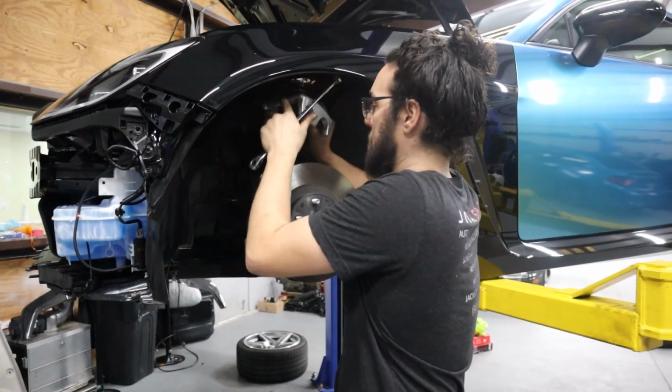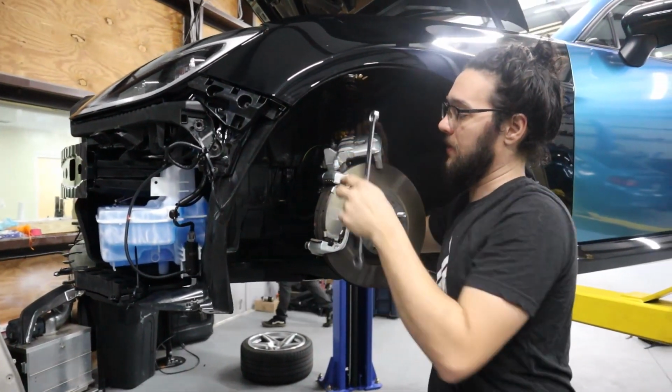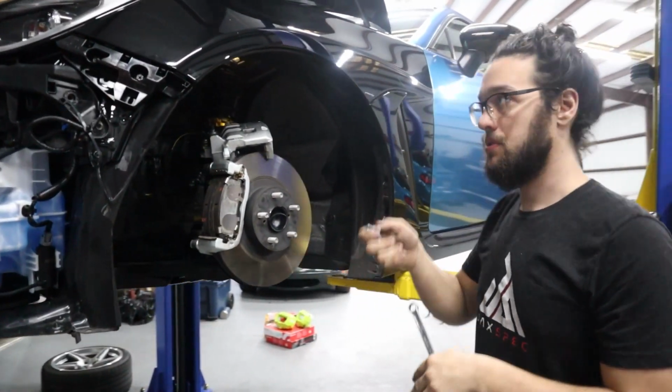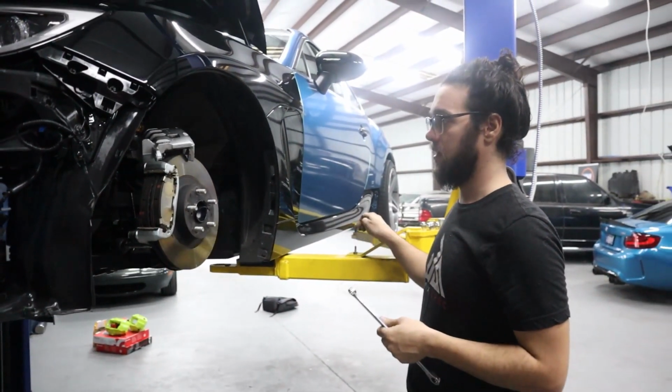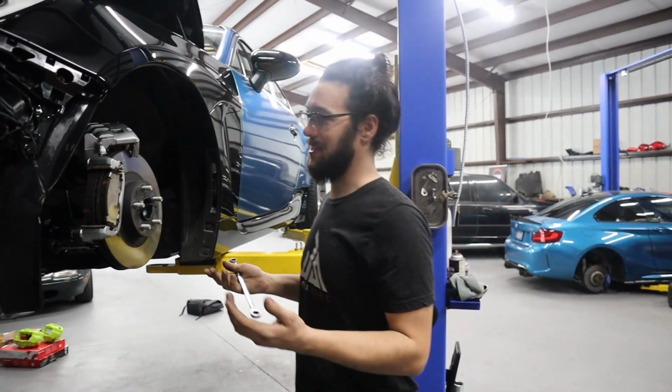Helps prevent any damage from the ABS module and everything there. Now that does mean you do have to have special tools to where you actually hook up to the reservoir and just pressurize the reservoir without, you know, somebody pumping the pedal a million times for you.